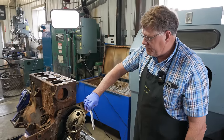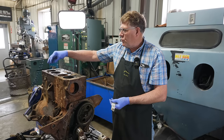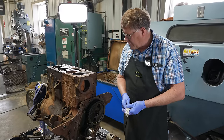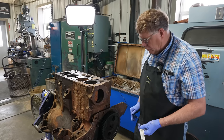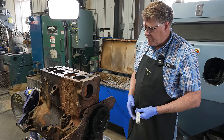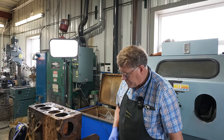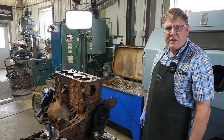So we're finding some funny things here. We've now got the timing off by one tooth. We found the notch worn in the side of that back cylinder where the wrist pin was up against it. And I'm not convinced that that's even recent — that may have been in there a while. It almost appears this was taken apart and that problem fixed. I think the engine's been quite hot, the way the cylinders looked and the way those bearings appeared to be melted. We'll never know — we just have to observe what we can find here and move on.